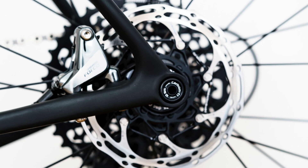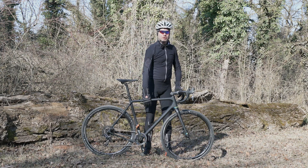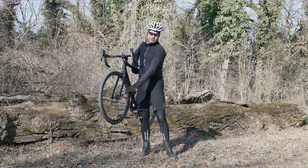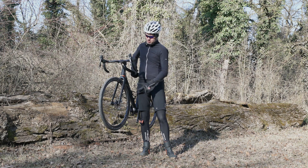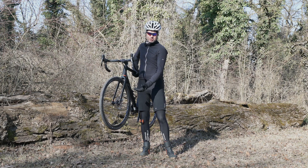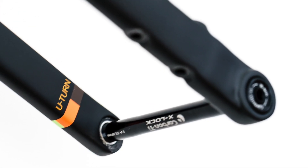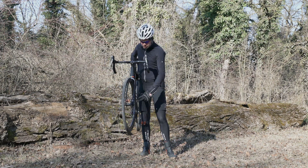We're not necessarily big fans of flat mount brakes, but there are some advantages — it makes things a little lighter if done smartly. Especially on the fork, we've made a big change. Normally a flat mount front brake has an adapter that lets you flip it to change between 140 and 160 millimeter discs — that's what the whole industry uses. But for a gravel bike, you never want a 140 millimeter rotor in the front; it's always 160. So we threw away the adapter and mounted the brake directly onto the fork, saving weight, making the system stiffer, and reducing the spongy feeling. It looks cool too — the bolts now come out the front of the fork.